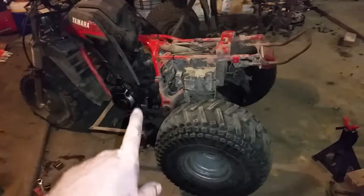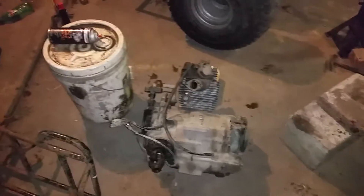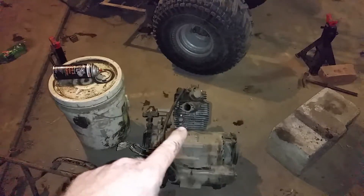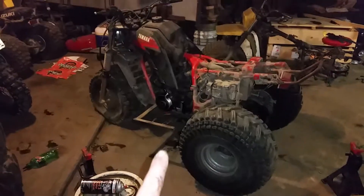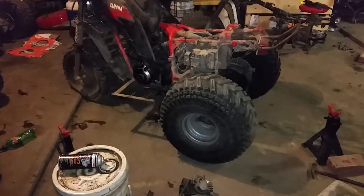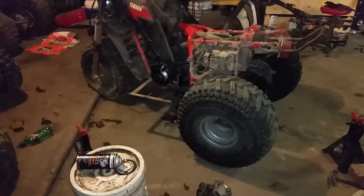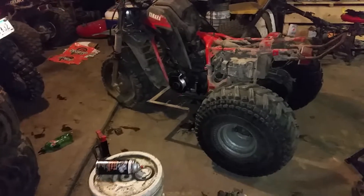The other thing I know might slow me up is on this motor — the oil breather fitting is a ton smaller on this motor for some reason. Neither of them had the correct parts for inside there, where it should come up to a little box next to the airbox. It does have a really long hose, and I might just heat it up and put it over that hole and run it into the airbox. I know that's not the right way, but I actually have the correct piece — a little black box — maybe from that three-wheeler.